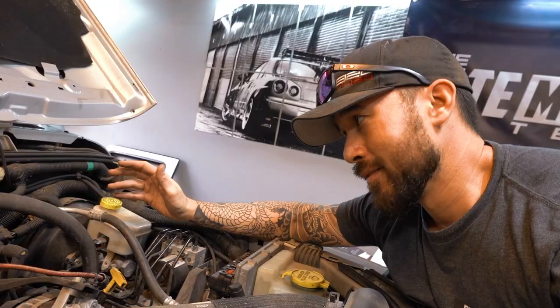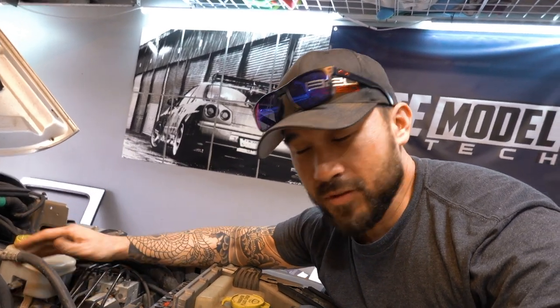Just be careful out there, because not all technicians know what they're doing. Remember: the brake booster is designed to make the pedal nice and soft. So for this Jeep, the symptoms of a bad booster are a hard pedal, a hissing/leaking noise when you press the pedal, and the car not stopping well. On this one you can just hear it bleeding out vacuum pretty clearly.